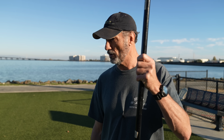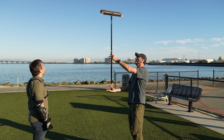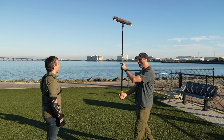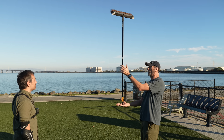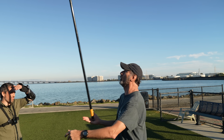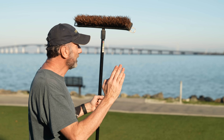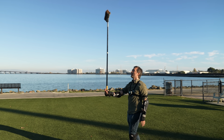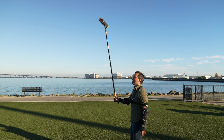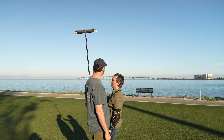When you're riding a bike, it's exactly the same as what we call an inverted pendulum, or balancing a broomstick on your hand. If I'm balancing it and I just start walking toward you, it will always fall away from you. If I want to walk toward you, it's easy enough — if I pull it backward, I can now start walking that way. I have to initiate the lean to turn into it. If you want to move the pendulum somewhere, you first move the base in the opposite direction, and now the pendulum is leaning in the direction you want to go, so you can move with it.